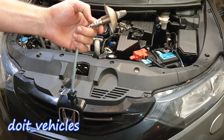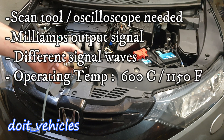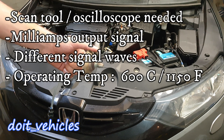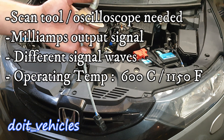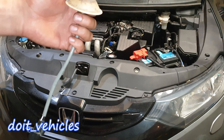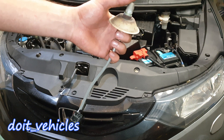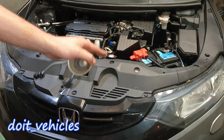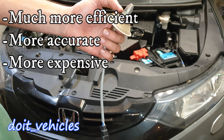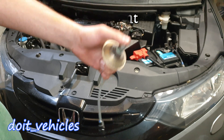Now on a wideband oxygen sensor, which is basically an air-fuel ratio sensor, you cannot read values with a regular voltmeter. The signal to the PCM is sent through current in milliamps, compared to voltage as on a narrowband oxygen sensor. The operating temperature for this sensor is much higher, at around 600 degrees Celsius. Most importantly, a wideband oxygen sensor will be more accurate in reading the ratio between the oxygen and fuel particles from the exhaust gases. These readings will be more precise and more efficient in helping the computer keep fuel economy and emissions as best as possible. That's the main reason wideband oxygen sensors are used much more often on newer cars, though they will be more expensive than the older ones.